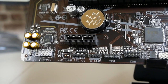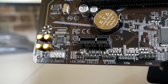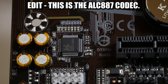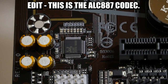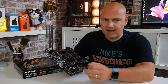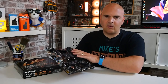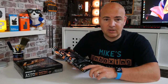You can use either the physical TPM module or the virtual TPM in your chip, if it supports it. Moving along we've got two RGB headers: one is the 5V addressable ARGB and the other is the 12V four-pin RGB — so both older and modern RGB standards are supported. For the HD audio connector, this uses the Realtek ALC892. There may be a revision two of this board with the ALC897; certain regions seem to have different sound chips. Either way it supports 7.1 audio and uses decent Japanese capacitors.